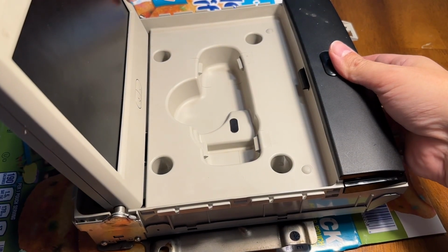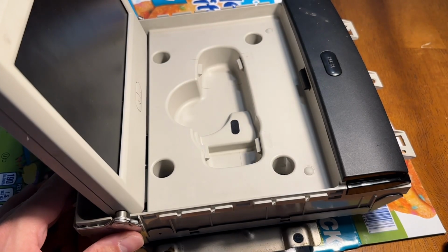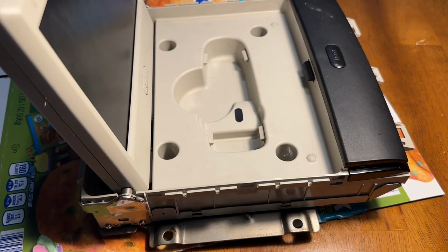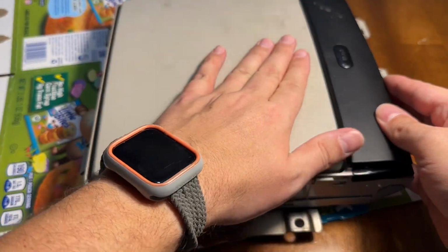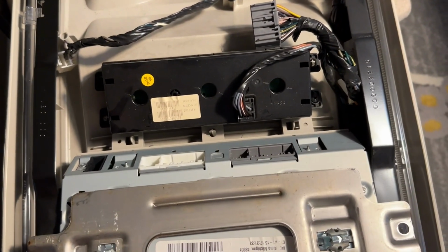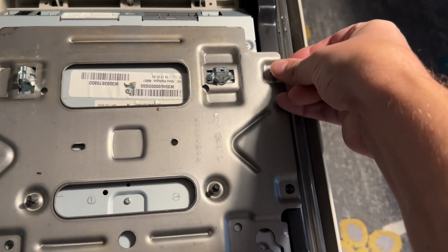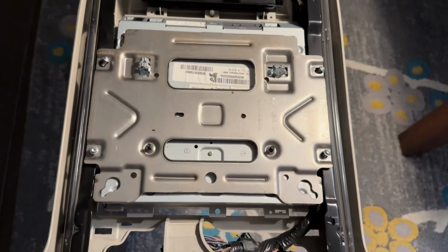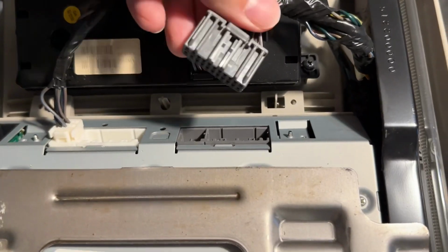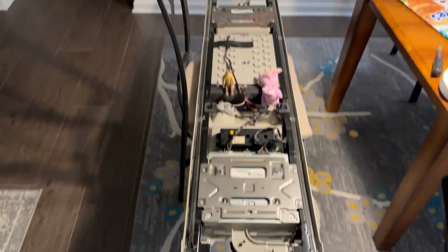Open it. And remember that the 7mm bolts go in the back, and the 2 Phillips head screws go in the front. Okay, and we're going to close the screen gently. Okay, now this is reattached. That's not seated. There we go. 4 Torx T20s. Now I just need to plug this in and this in. All right, now it's ready to be taken to the van and reinstalled.